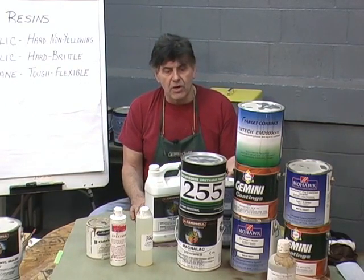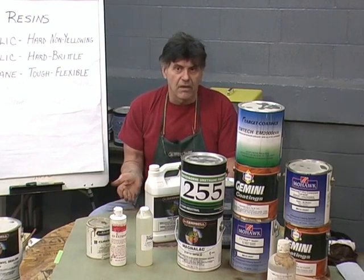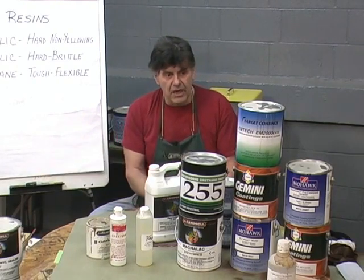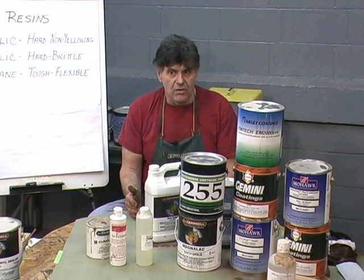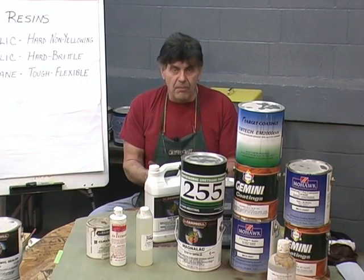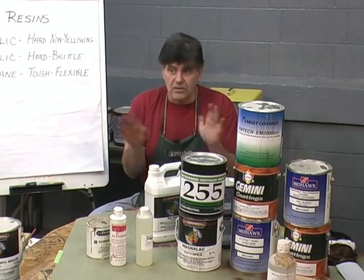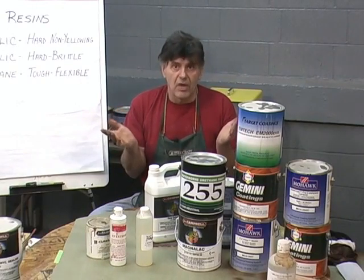A lot of these products are what's called self-sealing. What is that? Means that they feel like they sand well enough that you can use the product as the first coat and move on through, using the same product from beginning to end. Now, in the solvent bases, we have what's called, we talked about this a little bit, post-catalyzed, meaning you're adding a catalyst to it before you spray it. But you have very short pot lives. If you put the catalyst in, it's just like an epoxy, you've got a window of time you have to use it. After that, it's going to get hard as a rock. And whatever you do, don't leave it in your gun, because it's going to set up. It's a chemical reaction. It's not drying.